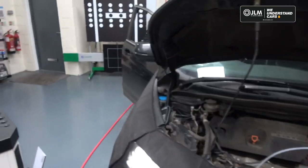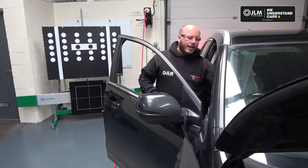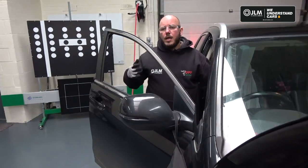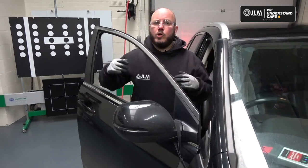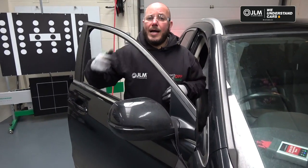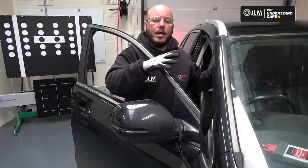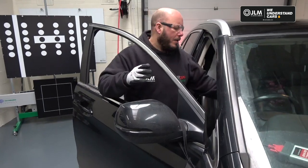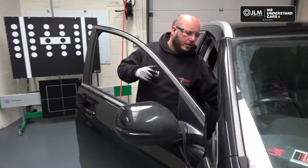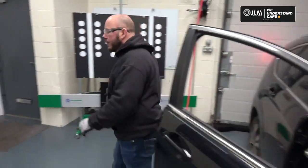So on this vehicle, what I'm going to do is go to around 2000 RPM. But again, experienced mechanics doing the job. If it's a later vehicle with a dual EGR valve, which means you have a pipe coming back to the intake from behind the DPF, what we do advise is keeping the engine about where we are now, 1400 or 1500 RPM. We can go a little bit higher on this, and then we're going to walk outside. So that's sitting nicely at 2000 RPM.